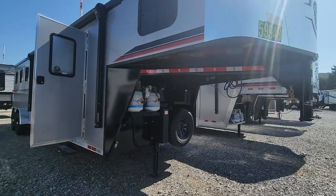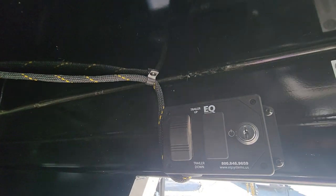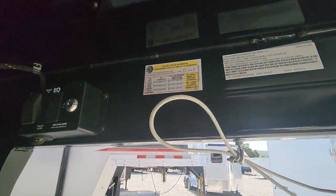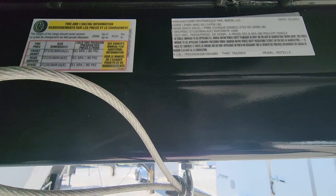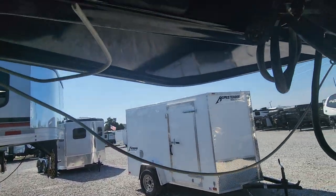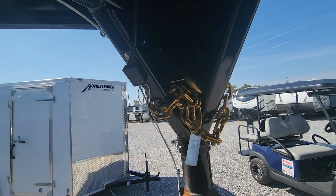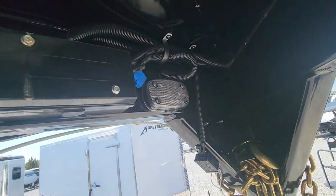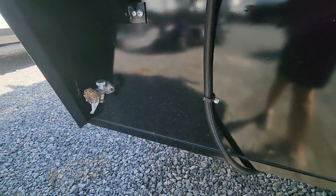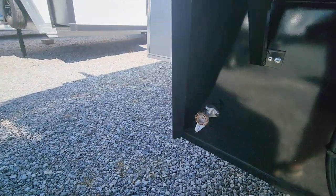Take a look at the front end here. You've got a single jack that is hydraulic and electric, so you just push that button to raise your jack up and down. You've got your battery station. The weight on this is maxed out at 14,756 pounds, so even at 17.2, you're absolutely fine pulling this trailer. You've got your breakaway switch, a zinc coated chain so they're not going to rust out. You've got LED lighting underneath here too, in case you're loading up in the dark. You've got a nice place to fill water buckets and a place to hold your slinky for your dump station.